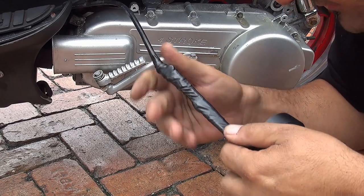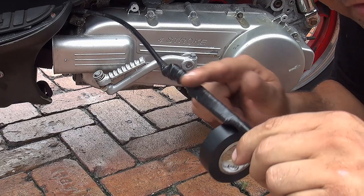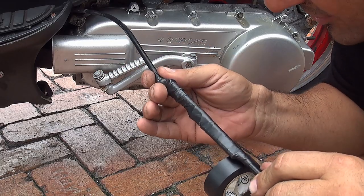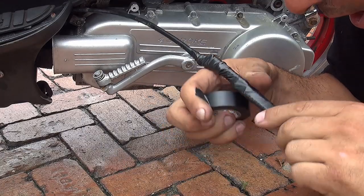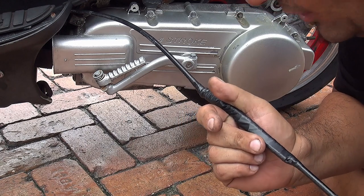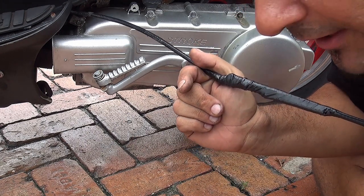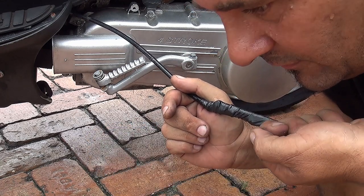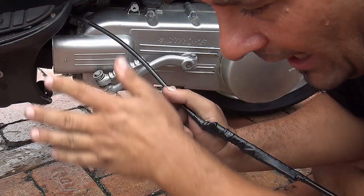When you're done and really satisfied with the taping job, you can tear the electrical tape. Now we're going to go to the front part of your scooter and pull this cable from the old one so the new cable gets pulled inside. Be careful — if you feel any resistance, don't pull too hard. You don't want to break anything or pull any wires.